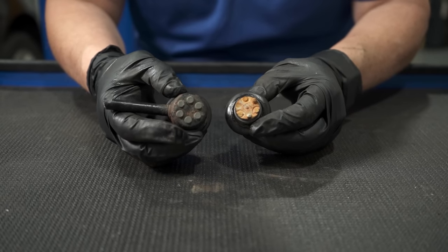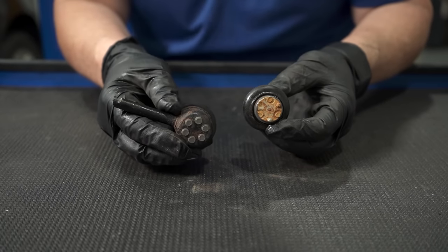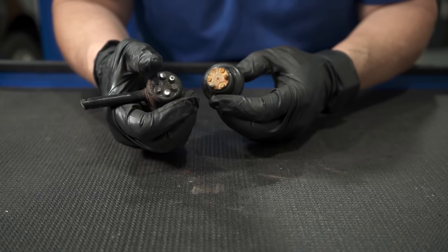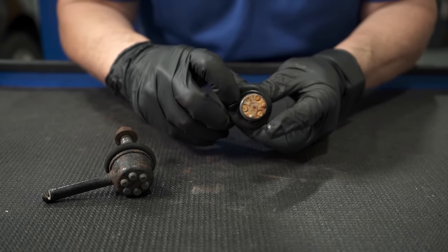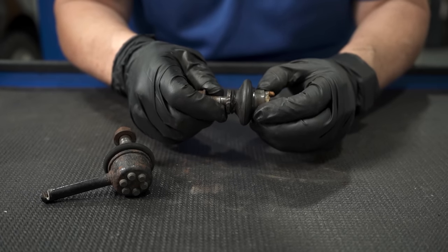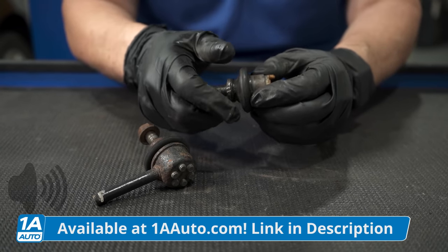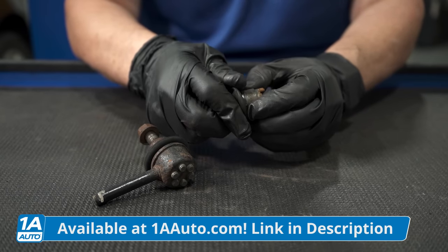Now I want to show you a close-up of what the end joint looks like on a sway bar link, and the symptoms — the warning signs before this breaks just like this one did. All those little dots you see are the actual plastic cap. They push it through and press them on, and that link gets attached to the joint inside. Now see this wobble? You saw how hard it was for me to move the new one. When it's going down the road, this is going to make a knocking sound — a loud metal-to-metal echo through the cabin — telling you the joint has way too much play.